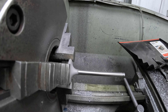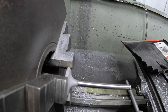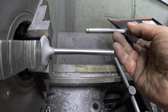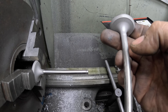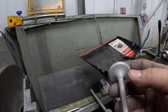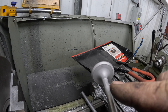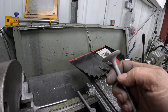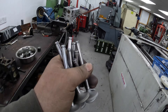If I get a standard one out — one I haven't done yet — you can compare a before and after. When I'm using the shot blaster, I don't get the stem. I point it downhill so the shot comes and hits the back of the valve and then across the front as well. That's really fine shot in the shot blaster. Right, let me get the other six done — that's all eight done now.